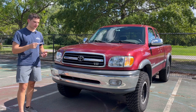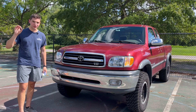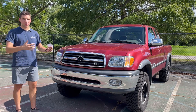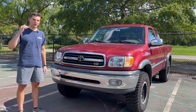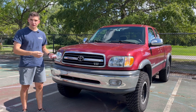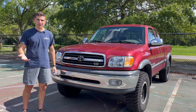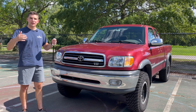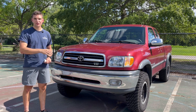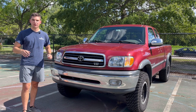Let's start with the pros. I love this upgrade — I think it's well worth the money, and it's not a lot of money. The light output is solid. Because they're projector, it makes for a much safer light output, but it's still really bright and throws pretty far — in my opinion, a lot better than stock. As far as the install goes, I have a video about it and overall it really wasn't bad. Another good thing about these headlights is that the box includes a resistor. A lot of times if you install LED headlights without a resistor, the car is expecting normal halogen headlights, so when the LED draws a lot less power, the car thinks something's up and throws warning lights on the dash, or can mess up functionality like high beams and fog lights. This comes with a resistor, so you don't have to worry about ordering anything separately. It was completely plug and play — no issues with high beams, fog lights, or anything. It all just worked right out of the box.